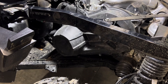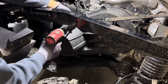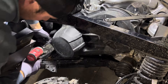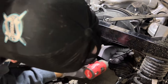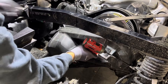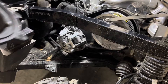I like to use a 10 millimeter to take off the perimeter bolts for the outer plastic clutch cover. Zip those off — we've taken a few out to speed up the video. I'm going to pull these four that we left in here. Sometimes for testing it's okay to run just a few bolts, then put them all back in after you're satisfied with the results. Set the bolts to the side, pull your clutch cover out — tons of room to get this out, makes it really nice.